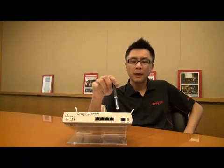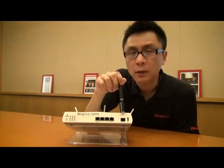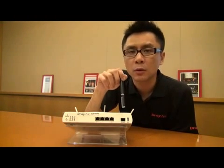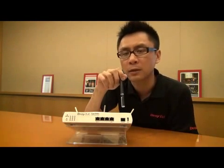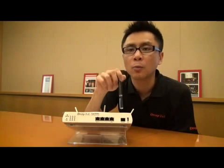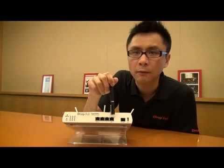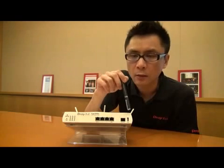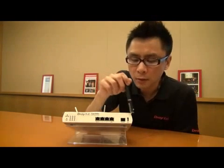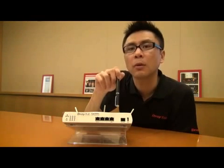Let's talk about the IPv6 features and start from the WAN interface. Vigor2850 series has three WAN ports. One is the VDSL2 WAN port, and it can support auto-fallback to the ADSL2 Plus internet. This means when your infrastructure is not ready for VDSL2, or the price is still too high, you can retain the current ADSL2 Plus internet on the Vigor2850. You can also configure a LAN port to become a Gigabit Ethernet WAN, and it also supports USB mobile broadband through the USB 2.0 WAN port. All three WAN ports can be configured to support IPv6 network, but only one WAN port can be configured for IPv6 at a time.